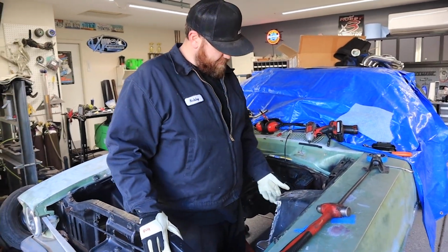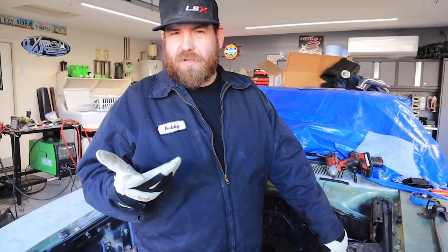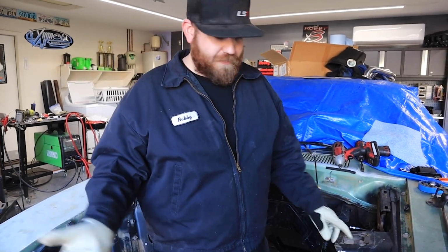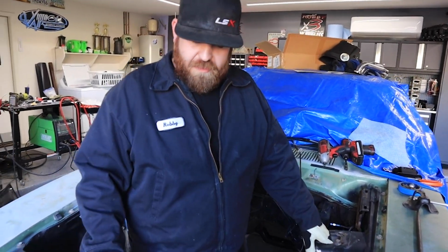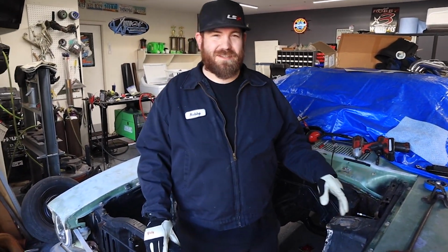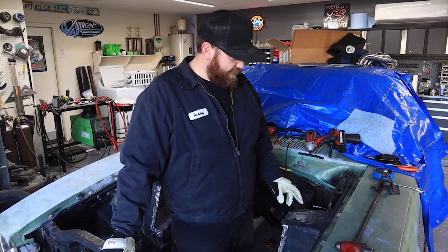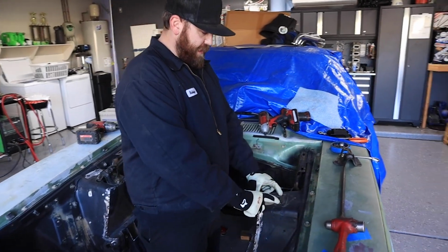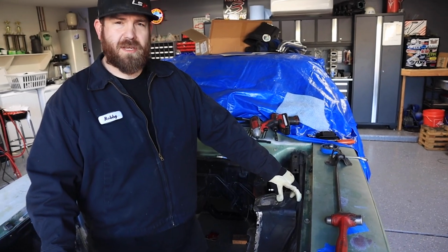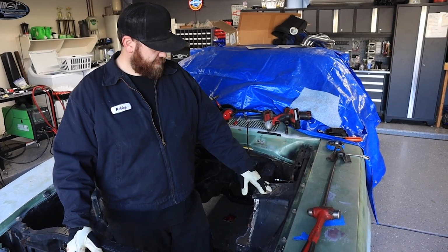So, why'd you do that? So the plan is, the last video we left off by saying that we were going to build some custom headers, and as much as I would love to do that, I would really try and use some of these pre-made headers. So what I've come up with is, I think if we take where this shock and spring was located and move it this way, we're gonna gain probably 3 inches more clearance for the headers.